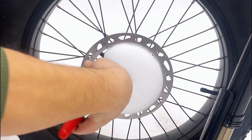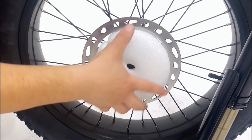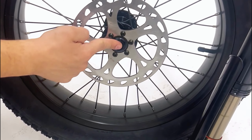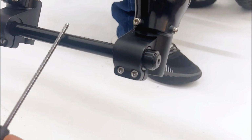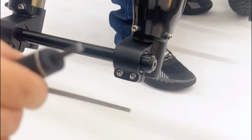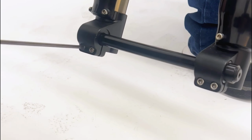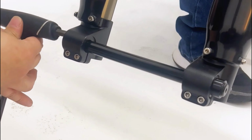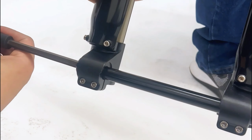Moving on, attach the front wheel to the front suspension forks. Remove packing material from the disc brake using wire cutters. Note the through-wheel hub and necessary axle fastened to the front suspension forks. With assistance, gently lift the front end of the bicycle, loosen the 4 pinch bolts near the axle, and use an 8mm Allen key to remove the front through axle.